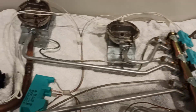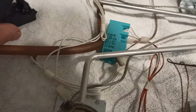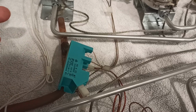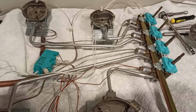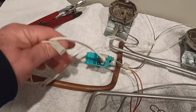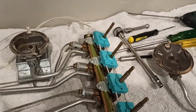And the first thing, coming over here to the more expensive one, here's the connector where the mains power comes into the unit and then gets distributed to that, which is a form of capacitor as far as I can work out. It's an igniter. The power comes around through here. These are the ones that go into the incoming power. They go to this fella here, and this fella here comes out 4 ways and comes over to where our gas knobs are.